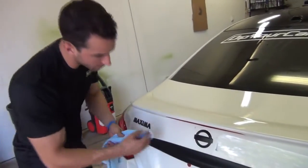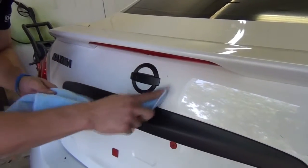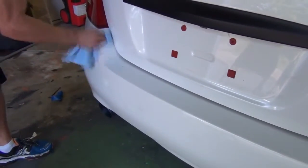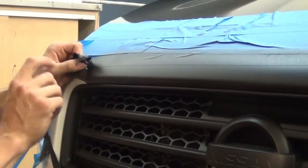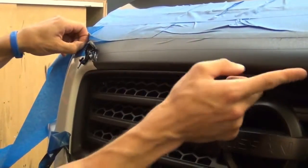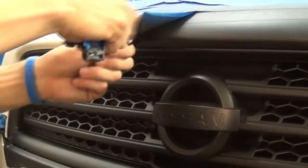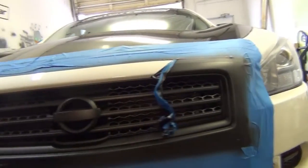This is where the microfiber towel comes in. When you have overspray that goes over and above where the tape is, you just take the microfiber towel and it's really, really easy to buff off. There's a little bit of overspray here on the bottom of the bumper — just use the microfiber towel, you don't even have to give it much pressure, this whole dusting area comes right off. If I covered the underside of this edge properly, it's going to be really easy to peel all the way down. If I didn't get good coverage under there, it's going to speckle and give me a rough edge. So far so good — I've got a nice even coverage all the way around, creating that perfect edge.